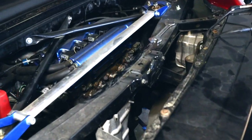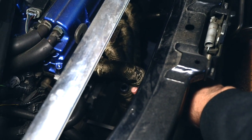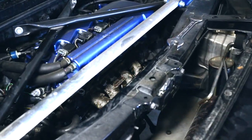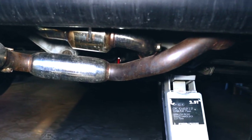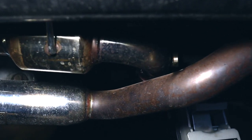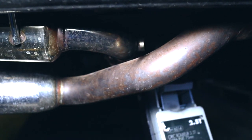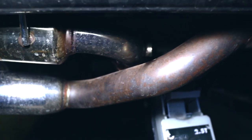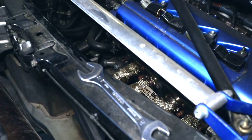Previously I had my wideband sensor down here — you can see the empty hole. I decided to put the exhaust temperature sensor there; it'll only cover two cylinders but it will still give a pretty good idea of how hot the car is running. For AFR I decided to go on the bung right here, where all four cylinders come into one, so I get the average AFR of all cylinders. Just be aware: if one cylinder is doing something weird you might not pick up on it and could get damage on just that one cylinder.